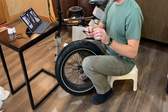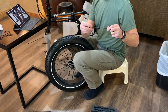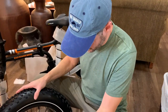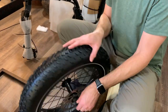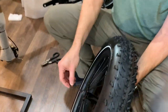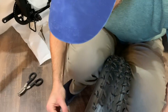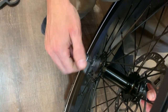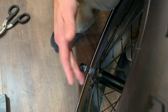They were describing that we need to take this end off, then one of these springs, and then they threaded it through the disc brake side first. That's going to go in, then my cone — I knew I would drop that. My little spring is going to go on followed by the nut. I don't know exactly how much to tighten it — it didn't say — but that at least looks suitable and good to go.